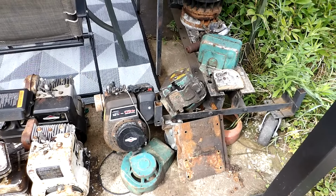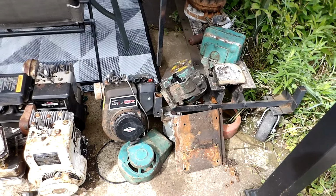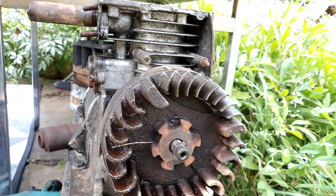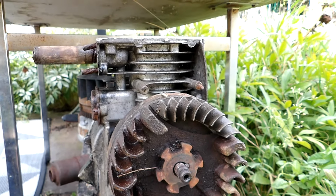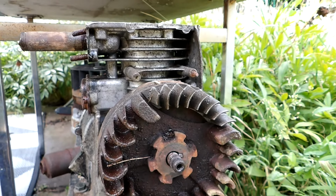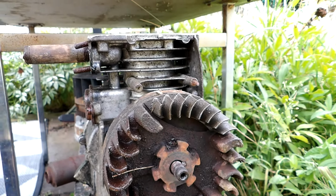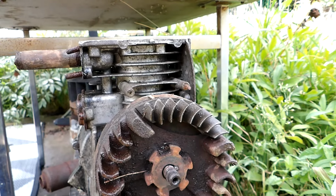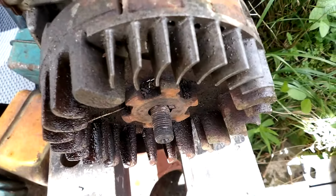Anyway, I'll shut the video down here and try to extract that, and then I'll start it up after one way or another. Well, there, I had success. Impact. I heated it up with, well, it's a brazing torch, but I wasn't using MAP gas. Heated it up pretty good for, well, pushing 10 minutes, I'd say. Sprayed it down with penetrating oil. Did that a couple times, and then hit it with the impact, and it unscrewed part way. Thread's kind of jammed up, so I stopped, screwed it back on right hand, and took her back off. It is indeed a left-hand thread